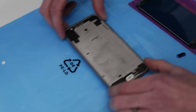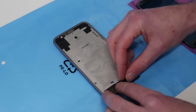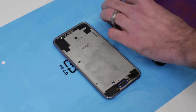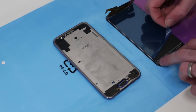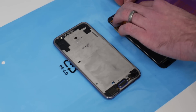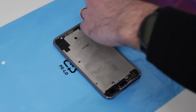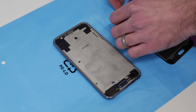Okay, so now what is left to do having cleaned up — I've just gone around and scraped some of the residual adhesive off. First of all we want to reposition the home button; we can make some adjustments to that once the screen is in place. Now I ordered this screen from Replayspace. I've already tested it before removing the chassis and all seems to be working nicely with it. So first of all we need to peel off that backing and then remove the adhesive which is going to set the digitizer into the frame.